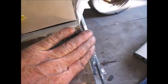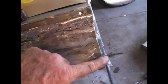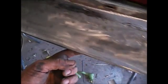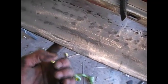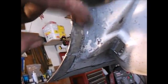I'm pretty pleased with this panel, I think. There's our back edge, and we got it. We just need to sand it down a little bit. It had little spot welds, or these little tangs that hang out, and they welded against the inside of the door, about 5 or 6 places on the bottom. So instead of that, I'm just going to do a little stitch weld, a little stitch weld, a little stitch weld. I'll weld up a little bit around this corner on the back side, where my splits are. Weld them up, grind them down. Just keep that door skin from coming loose and rattling around. You can see it. Didn't turn out bad.